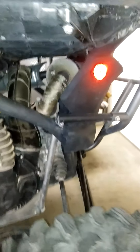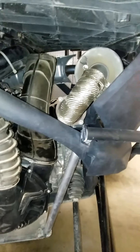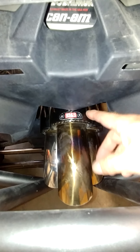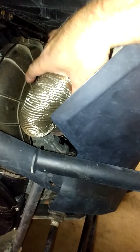So I went that route. Then I also put on the Yoshimura — the one specifically made for Can-Am. I wrapped this curve pipe right here just because of the close proximity to a few odds and ends. Probably not required, but I did it to keep the heat down. The upgraded Yoshimura one has a carbon fiber cap, and then there are three exhaust ports — one tube that I believe is right at two and a half inches round, then it splits into three two-and-a-quarter-inch outlets.